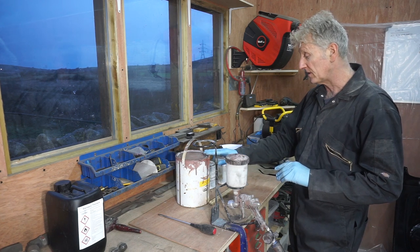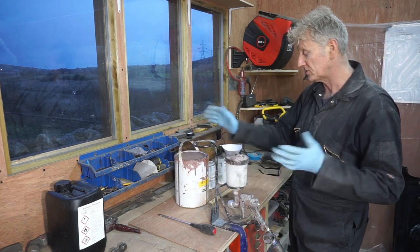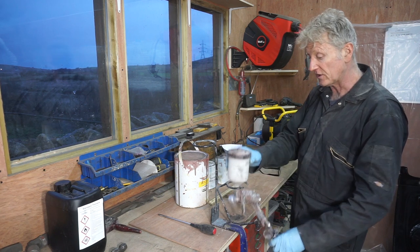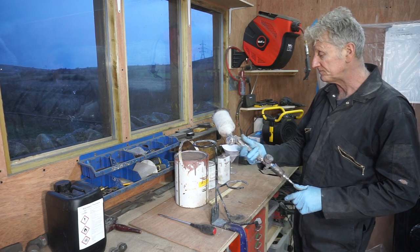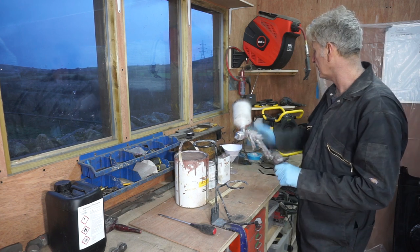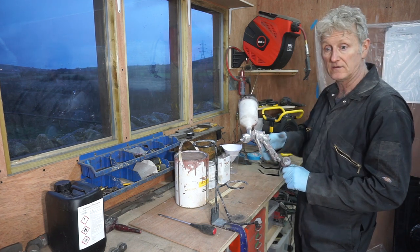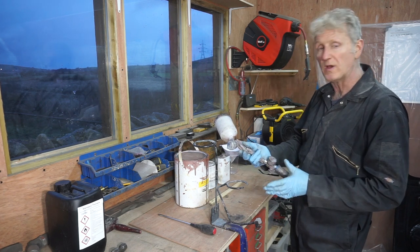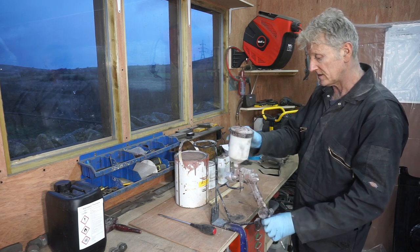I'll get that mixed up. By the way, I've got no affiliation with this company at all. I just like the product and I've used it before, and I'm happy with it. The gun I'm using is a cheap and cheerful 25 quid internet jobby. I've got a water trap filter on the bottom of it, another water trap over there, and two more between that and the compressor, which is outside. And I usually run it at about 2 bar. So let's get started.